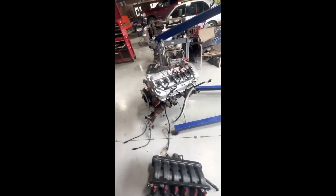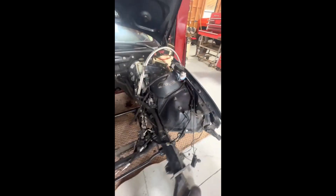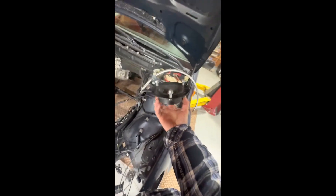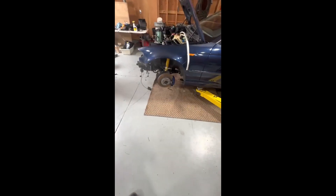I think it turned out pretty good — it's going into my 2004 330xi. A couple other things to note: I'm going to swap the top hats out to E36 top hats because they're shallower and the car sits monster-truck high, so that should lower the front end a bit. I was also thinking about trying to do a gold tag rack in this, but from what I've read they don't work for some reason. I'm going to measure these before I put the engine in and note that measurement down.